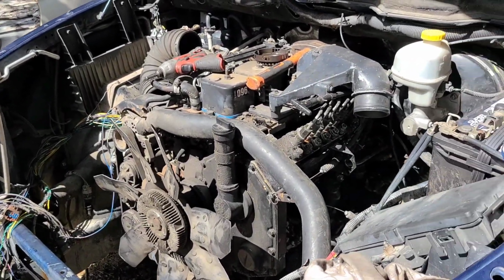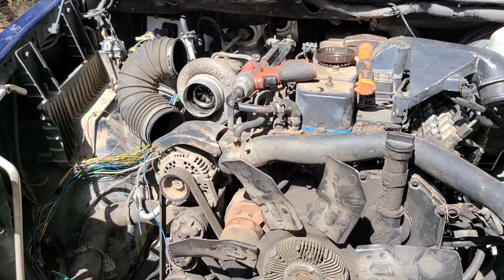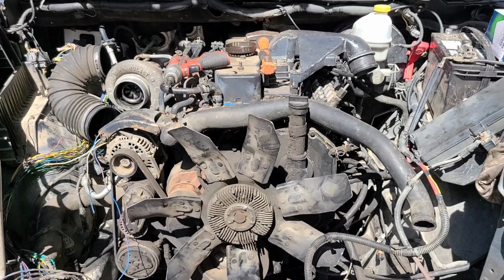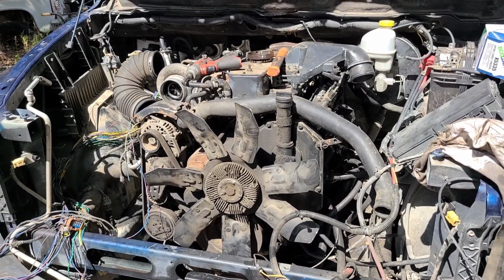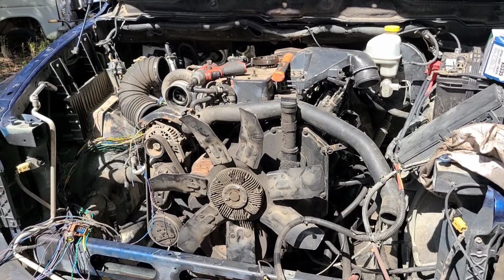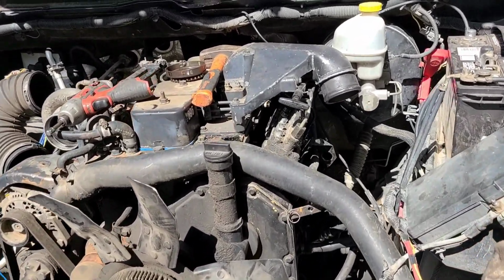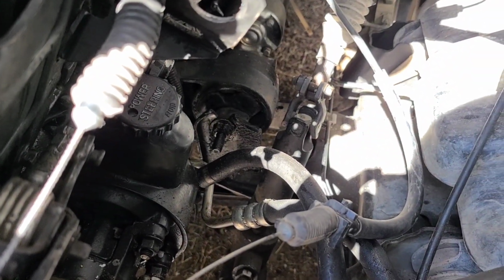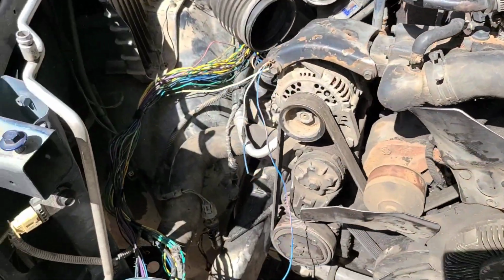All right, made a lot of progress off camera in a bit of a time crunch, but you kind of get the idea. As far as fitment, it fits in the hole of this V6 one anyway. Actually lines up with the mounts, but the issue is the mounts put it too low. So I cut the 12 valve mounts, see all the way down there, and welded them on, and it just makes it a little bit higher. I did that on both sides.